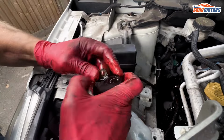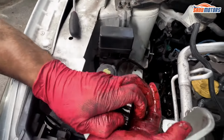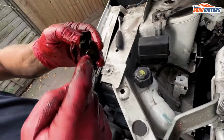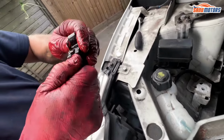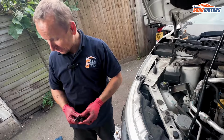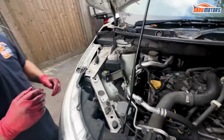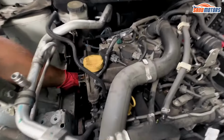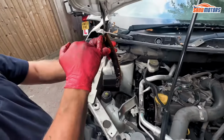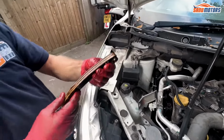It's supposed to be like a ratchet mechanism in there, and that ratchet's not doing anything. Well, I don't know, the ratchet itself probably does something, but the actual shaft itself is seized up. It's supposed to be out, keeping the tension on the chain, but it's not doing anything. It's not very well. The guide just slides off. It's got no bolts or anything. It just literally slides off. I mean, that's one of them.